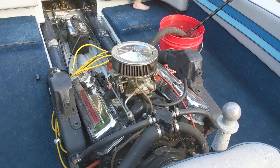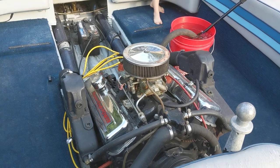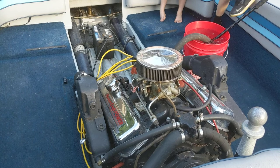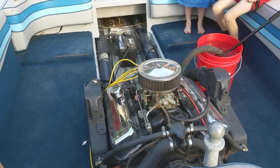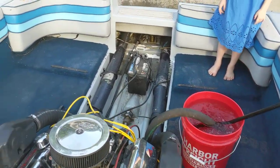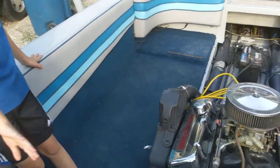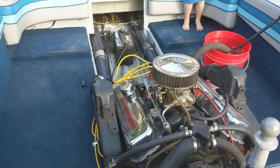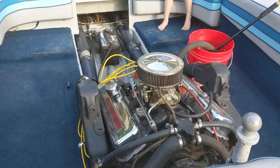It actually runs a lot better. I just changed it and I had a pretty good knock — just a ticking — and put some Shell Rotella in it. I like this a lot. It's easy to kind of have a placebo effect there, but I think there's a real difference. Just having a thicker oil, there's like no tick at all.